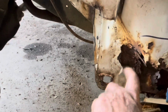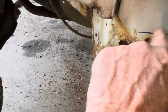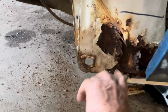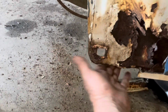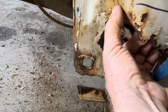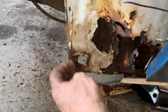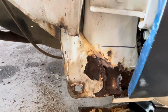Get all of this off, or the outer rocker off up through here, and probably cut along this where I put this black line, and then put the outer rocker on this. This is a part of the cab floor support here, and the fender bolts through here, so I've got a good alignment pin there. And I think we're good if I come right straight across into there and then just peel all of this off. That's my thinking anyways. We'll see how that works out.